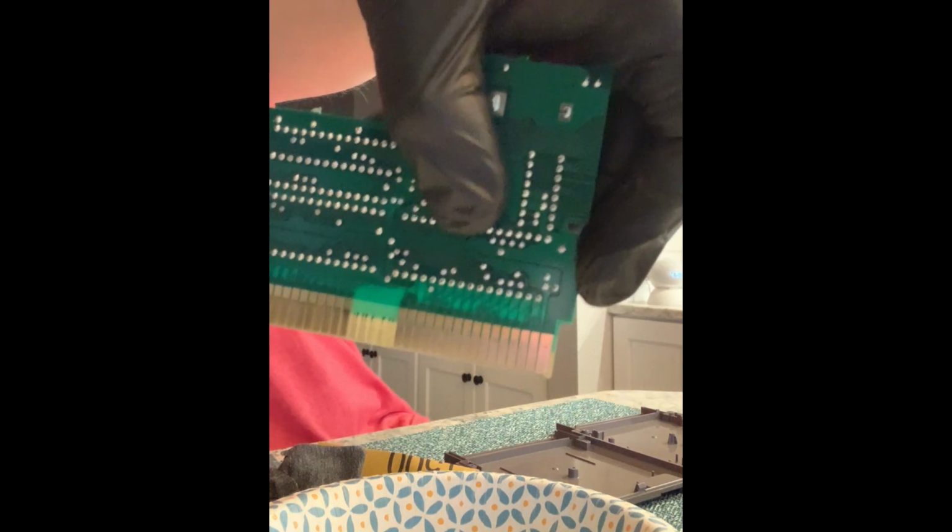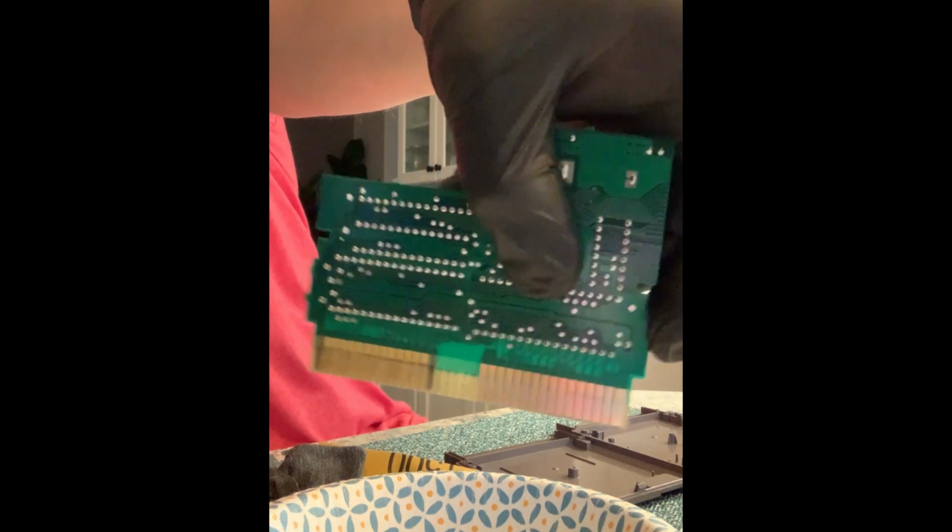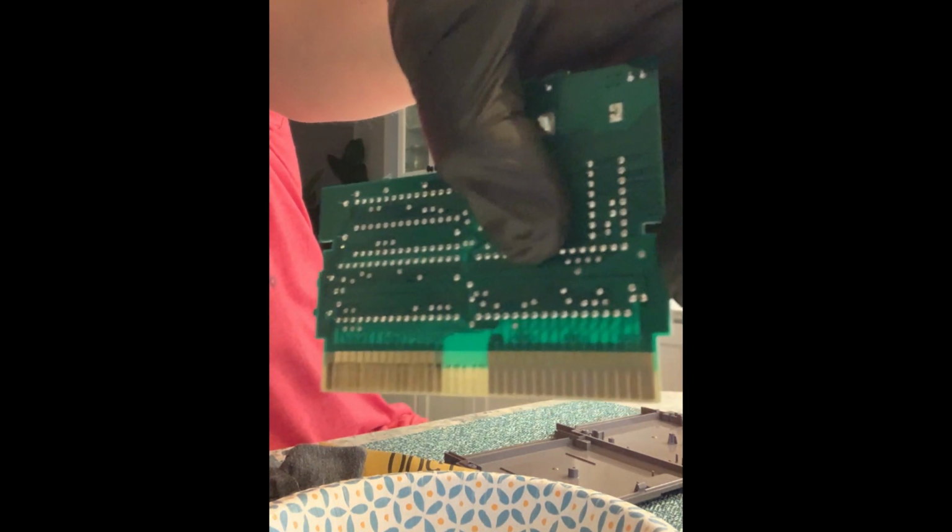Inside, the plastic was actually broken. So where that motherboard sits, if you push on it hard enough, you can actually break the plastic, and that's what happened to my game. This game did not work at all. I took it apart, so now I'm showing, see, the left side's dark, the right side's polished up nice. Yeah, that's what you're looking for.